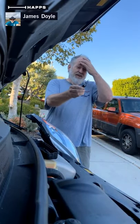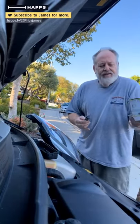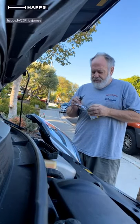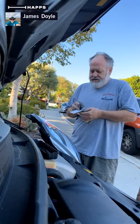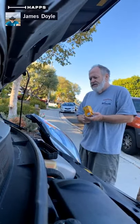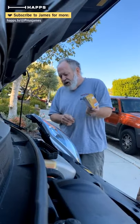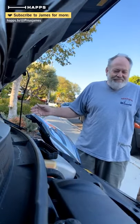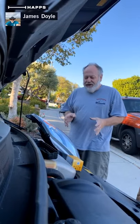This is the old lamp — by the way, from the old bulbs — when I replace the new fixtures I put in new lamps also. These things are about $53 a piece from Amazon. This is the original lamp for the Generation 2 Prius — the Philips ones that came as the OEM bulbs. I prefer to use OEM bulbs especially when they're still available. For testing purposes on this new light, I was going to put in this used one, but it looks like I'm still going to have to take the ballast off the old light to even test it with this bulb.